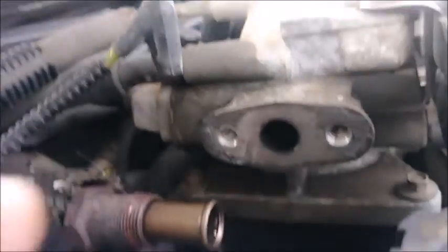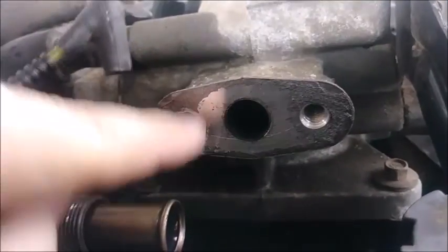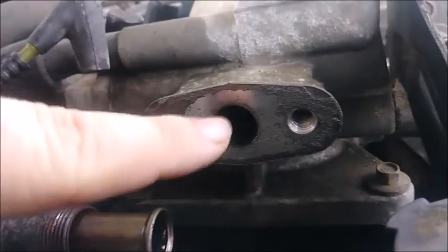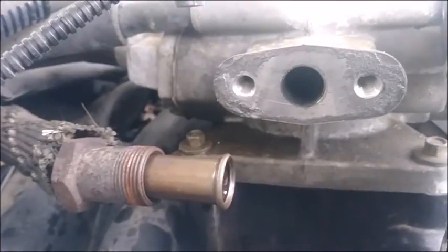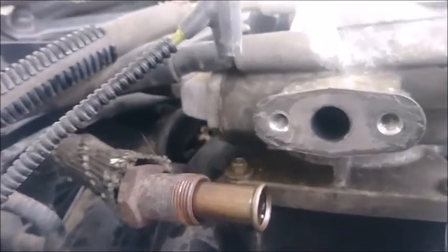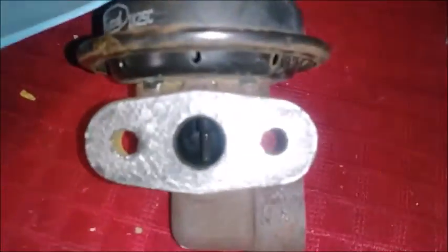Two 10-millimeters come right out and then the EGR comes off. I don't see anything clogged. I already sprayed an entire can of carb cleaner down in there, so it's possible I dislodged some stuff that got stuck in the EGR and maybe clogged up this tube - but the tube itself doesn't look plugged up either. I sprayed a little bit of brake cleaner in there too. We'll let it evaporate before we start the engine and clean out the inside of the EGR. I'm still going to go to the scrap yard and pick up another EGR just in case the valve is bad.